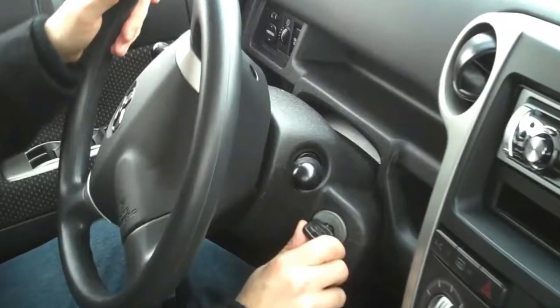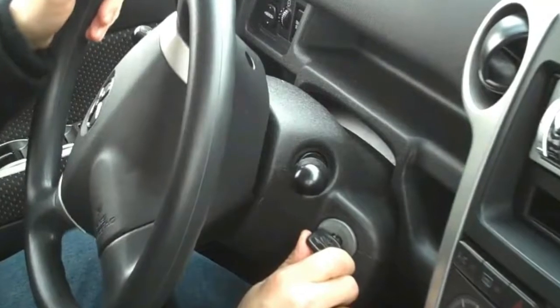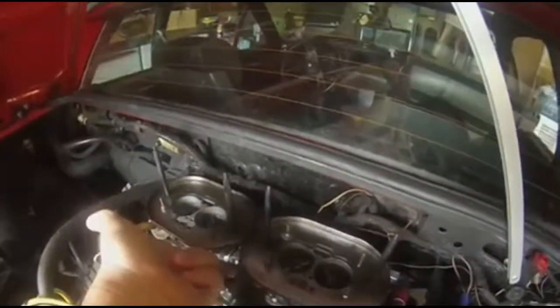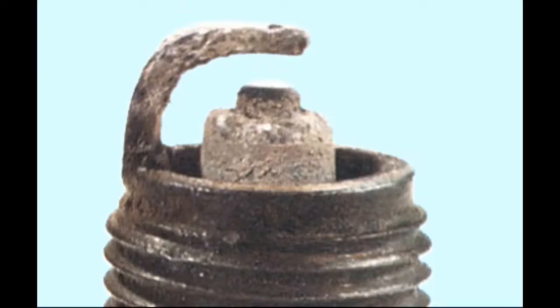The symptoms of a lean engine are: hard starting, and the engine will run better when warm. An engine running slightly lean will flatten out when accelerating. If it is excessively leaned out, it will often cough back through the intake during acceleration. Spark plugs are tough to interpret because modern engines try to run at a ratio which shows a very light brown or white insulator. A very lean engine will show a blistered insulator.